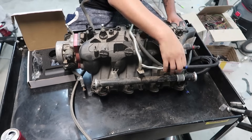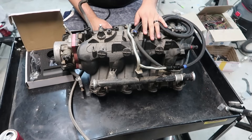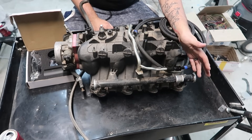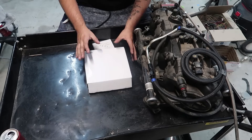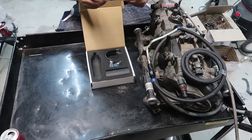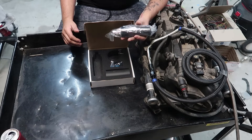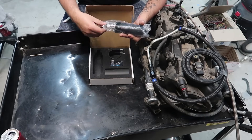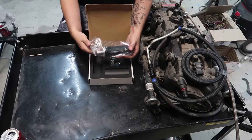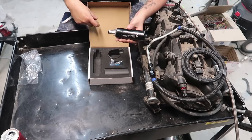Once you have your fitting on there you're able to screw your hose onto that. About halfway down the frame of my build is where I usually attach my fuel pressure regulator if this is a returnless system, or just run my fuel pump if it's a return system. What I have in this box is basically my fuel pump kit that I always buy — it is a very cheap Chinese Walbro knockoff. This is a Walbro 392 knockoff, an inline fuel pump that flows right around 255 liters per hour. This one is from JDM Speed Motors, right around $45 for the kit.